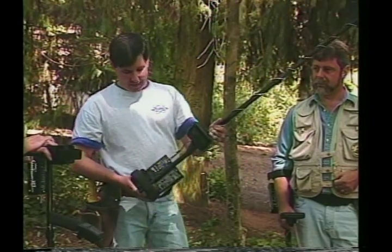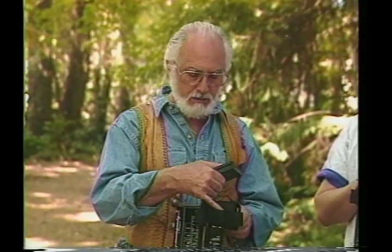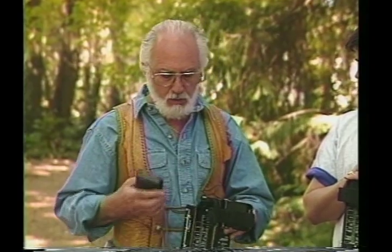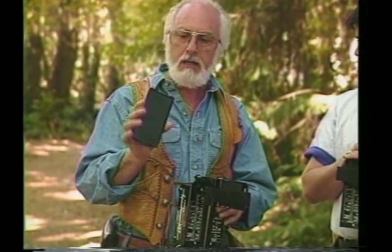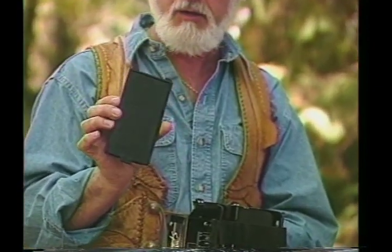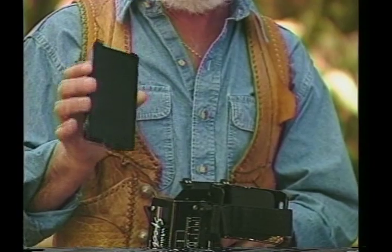Jimmy, you've got some ideas for us on batteries. What about that? Yeah, I'd like to explain the new battery pack that White's has designed. We've all been used to the drop-in battery pack. White's has been famous for that drop-in pack. It's 4 C cells. Well, now, because of the small size of this detector, the small package size, we've designed a battery system which incorporates 8 AA batteries, thinner and longer and lighter, to be able to be dropped in as well.